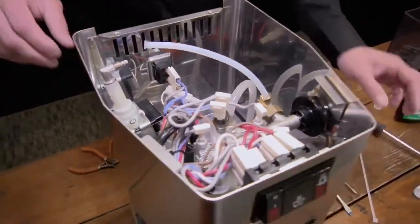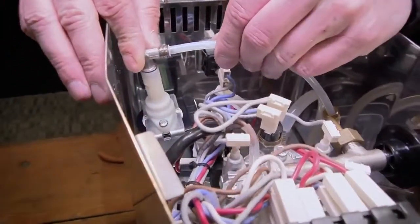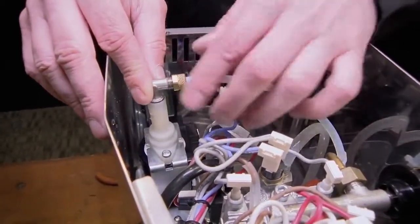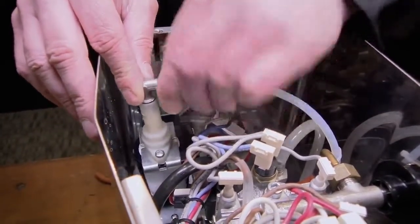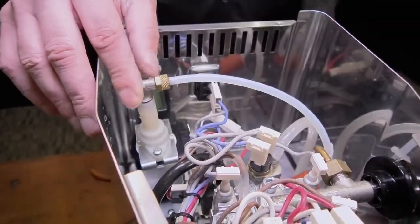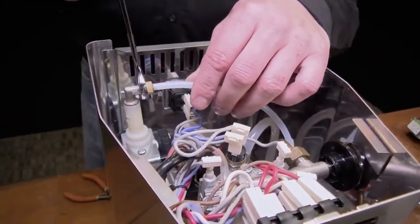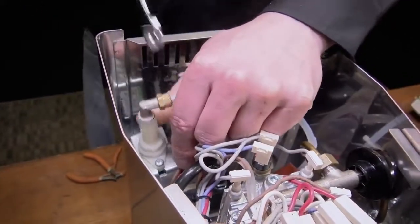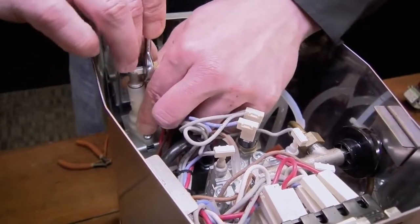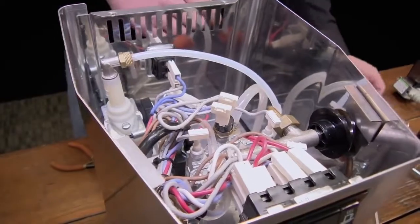The bracket is back in, the pump has been replaced. We're going to slide this tubing back onto the neck, then take the nut and start threading it on until we can't turn it anymore with our fingers. Then take the 12mm wrench, hold the neck, and go until it stops. You want to make sure that flare is sealed up against the elbow.